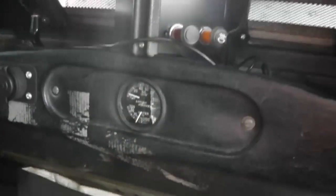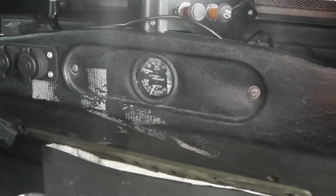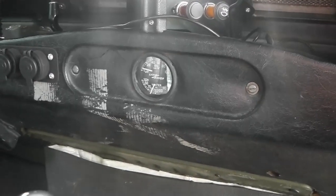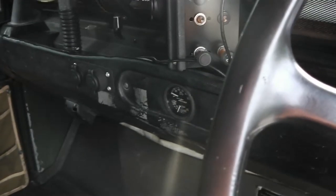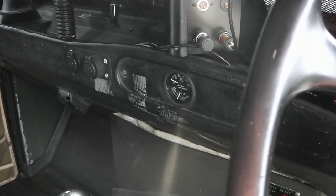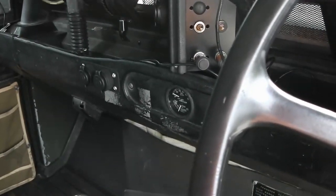You can see that gauge is now reading. I think the next thing to do is to clean up the dashboard — that really is a bit of a mess nowadays. The engine actually holds a better temperature, sits at about 75–80 degrees while you're driving. It's an 82-degree thermostat, but yes it's somewhere between there, and it's obviously warmer than what it was before.